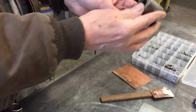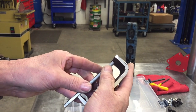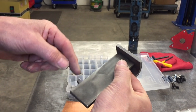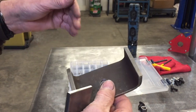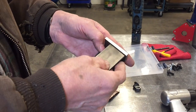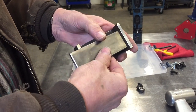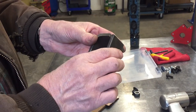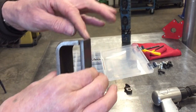Now, some people will box a frame in with the plate inside the frame. I've seen guys do it where they actually leave a little step there. I'm not a big fan of that, mostly because there's a ton of work trying to fit the plate in between the frame. On my truck the frame was kind of wonky here and there, and it would have taken a ton of time to hand-fit those boxing plates. It was way easier to put it on the outside, scribe it, grind it, clamp it, and then go ahead and tack it.